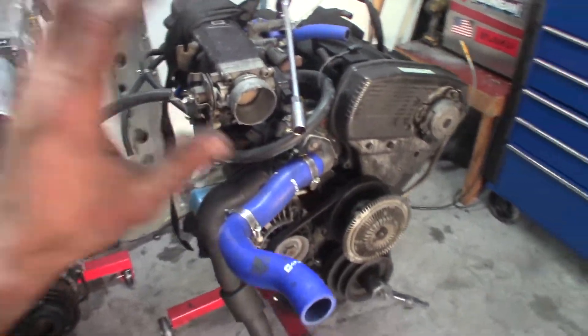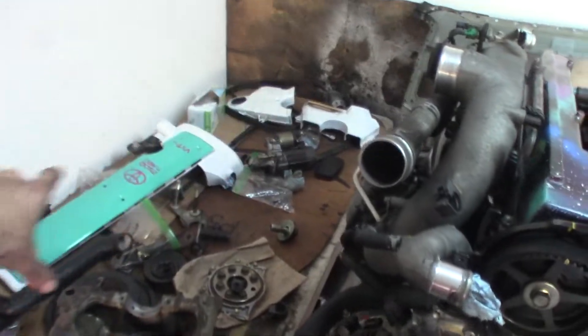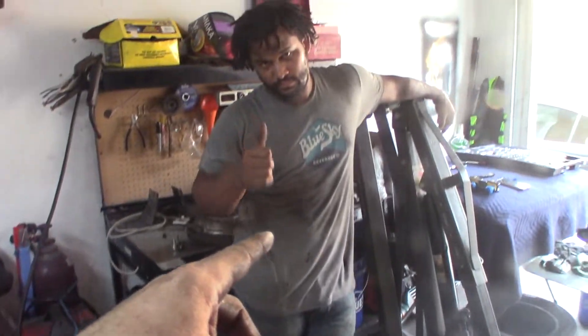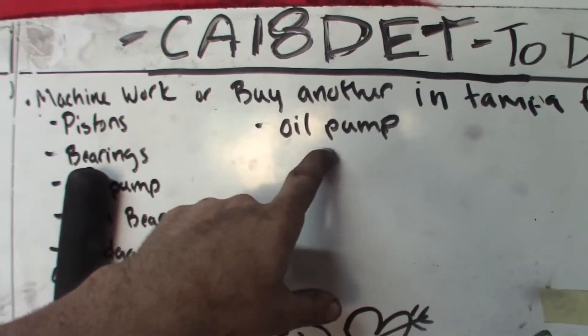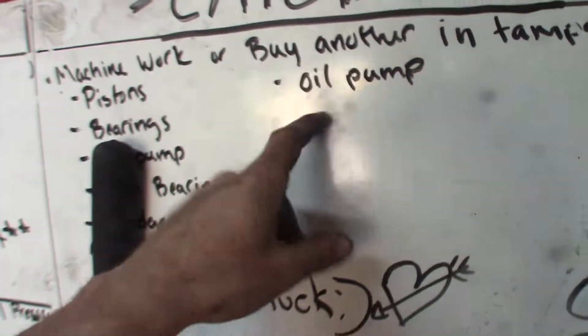She's off the engine hoist and on the stand here next to the JZ. The JZ is back in time - got the timing belt on, Winston is just waiting on paint and such to get his plastics cleaned up, then waiting on the harness and some goodies. About the CA: the issue with this one and why I have it up on the stand rather than just dropping it in my car is because supposedly it needs an oil pump. I don't really want to take my chances and throw it in, start it up, and have no oil pressure and lose a bearing.